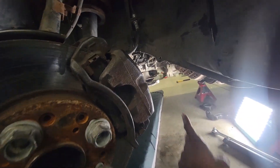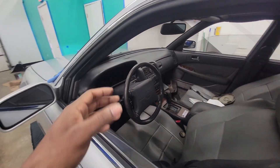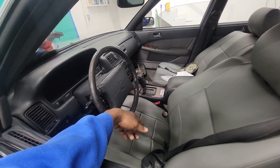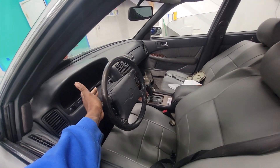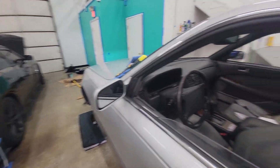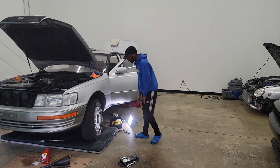A side note when working on this: you definitely want jack stands, as always — be safe. Getting the steering rack out, you can see the transmission right here. It didn't really leave enough room to get the rack out, so you have to jack the transmission up a little bit. Once you do that you should have no issues. Disconnect the steering and keep it as straight as possible — I'd recommend wrapping the seat belt around it to hold it straight.